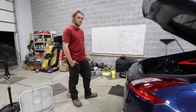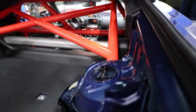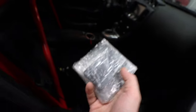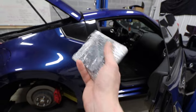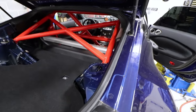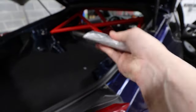We've got Malcolm here helping out. We got it all installed and then realized — where are the back plates? Everything is supposed to come through and then have hardened steel back plates to sandwich the sheet metal. These are the hardened steel back plates, drilled out so they fit up. They are super important because if you don't sandwich the sheet metal and there is a collision, all the strain gets put directly onto just the sheet metal and those will tear away. We want this to be super safe, so we're putting them in now.